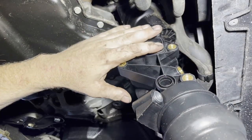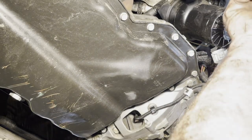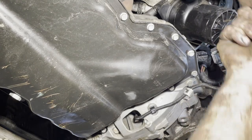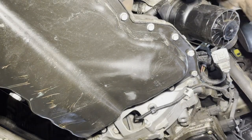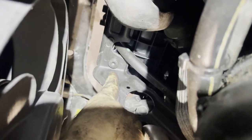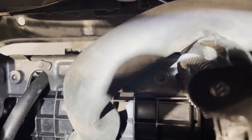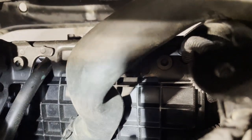The cooler bolts to here. Alright guys, I think I'm just going to pull the intake. There are two screws that go right up into that right there. I'm going to take out this one here. Alright guys, I'm going to take that bolt out as well while I'm down here, and then that one over there, and then I'm going to go up and take the intake loose.